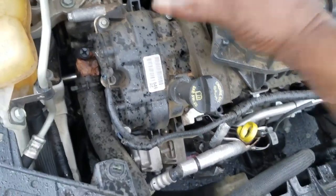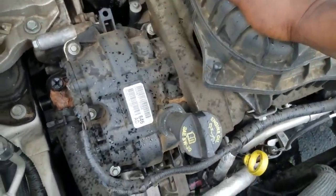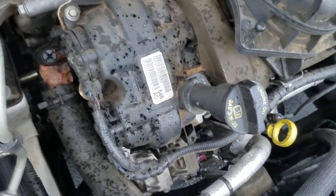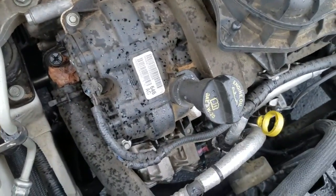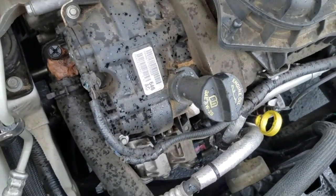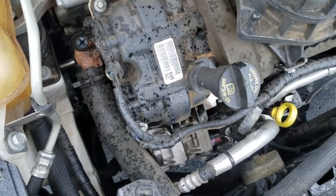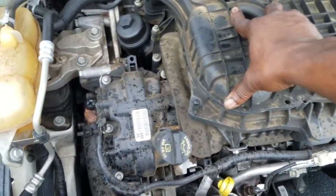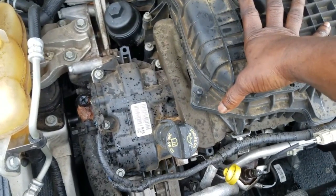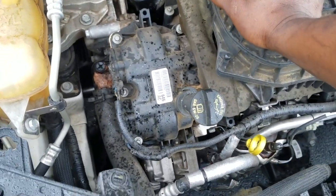It's likely a main bearing, maybe wedged together, froze together, seized up, because without lubrication it's really hard to tell which one caused it until you tear it down. But you could have easily damaged other engine parts. So I said that to say this: it becomes extremely risky to try and repair. In fact, it's out of the question here at the place of employment where I'm at right now. It's not going to happen.